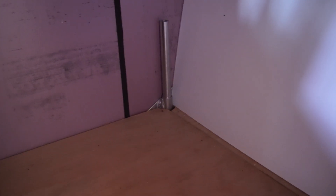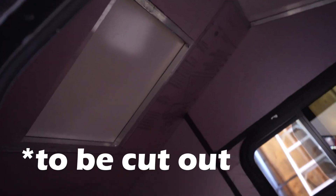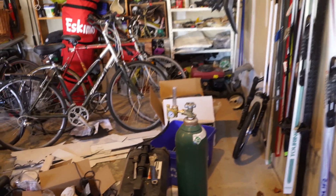The stabilizer legs — I think I'm going to find some way to cover them. Obviously there will be condensation if I just leave them like that for winter camping. I'll address that after I put the whole liner fabric on the side walls. I've got to pop in a couple pieces of insulation that came out while I was putting the roof on. There's the cutout for the roof vent, and before I do that, I'm going to wire in a reverse switch so I can use it as a ceiling fan as well as an exhaust fan.